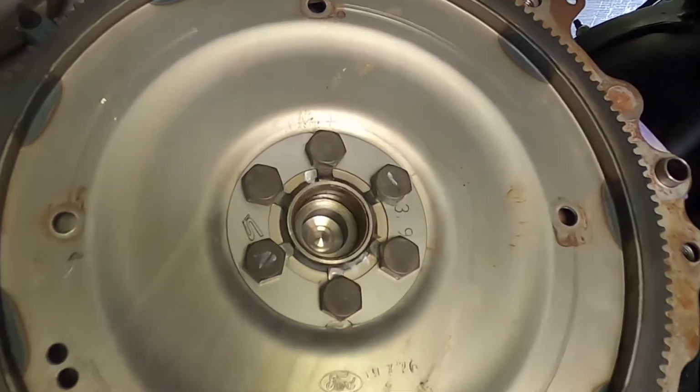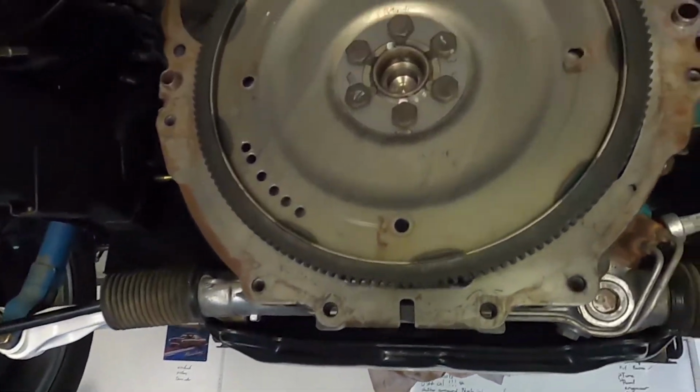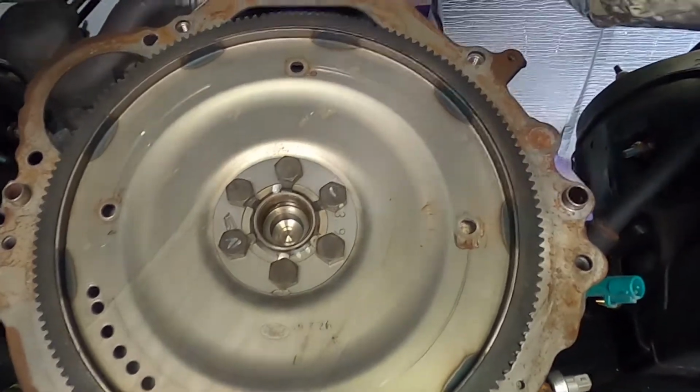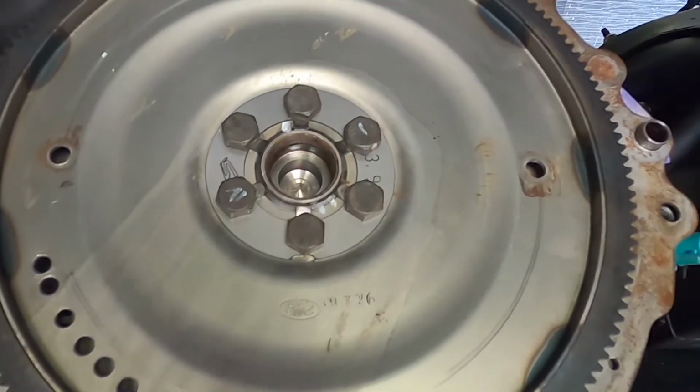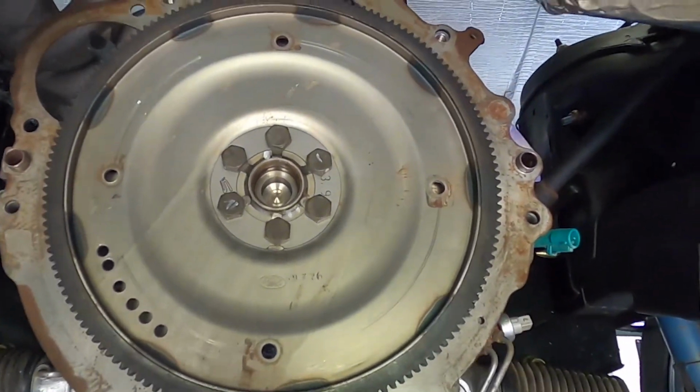All right, so we've got the plate on, it's all torqued up. Had Neil, thank you very much, Neil. He was on the front on the crank, making sure I don't just rotate everything. So it's all torqued up to 70 newton meters as per the specs, a little bit of red Loctite for safe measure as well as the lock plate.